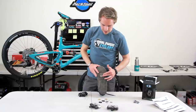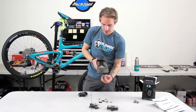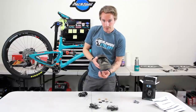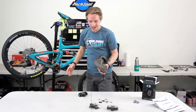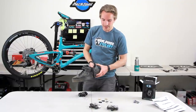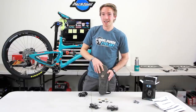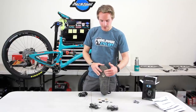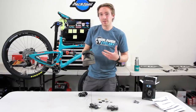The next thing — also really nice to do — is slide the cleat away from the bike. Position it all the way back and then away from the bike. Going away from the bike is going to prevent it from whacking into your crank arm, seat stay, or chain stay. That's pretty common, especially if you have big feet or you're riding bigger downhill-style clipless shoes. My recommendation: all the way back, all the way over. But personal preference — make sure you test and see what you like. You might like it all the way forward, or you might like it slid in a bit more for a narrower Q factor, which is technically a little more efficient.